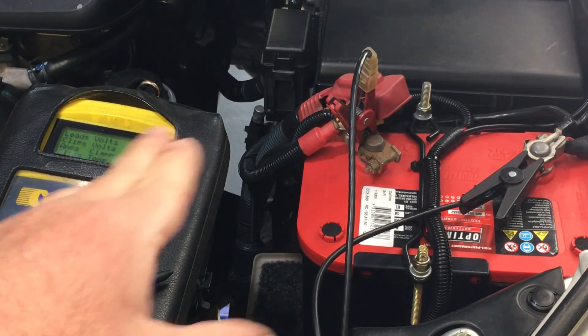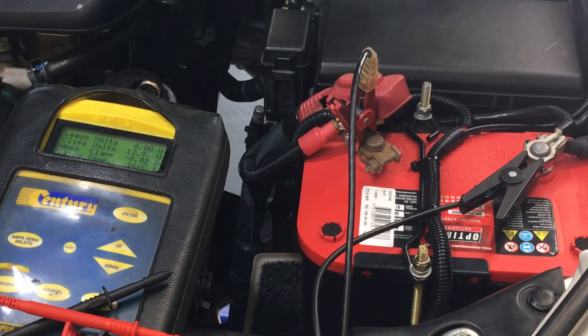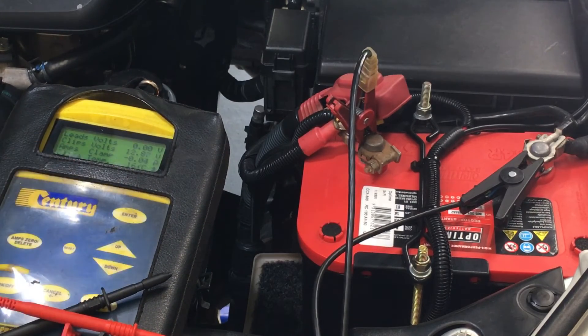Okay, so what have we got here? Now it's up to 12.94. Does that mean this battery's charged? No - that's what I'm talking about. It's just been charged by the alternator. Now we're reading 12.87. So let's assume we just jump-started the vehicle, the engine starts, and we see an alternator charge rate either side of 14 - with the booster diode it was 14.5. Without the diode it would have been about 14. It doesn't stay that high; it does drop down - that's how variable voltage alternators work.